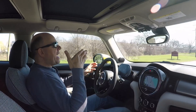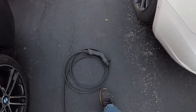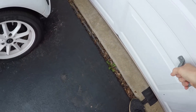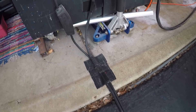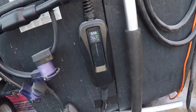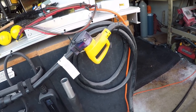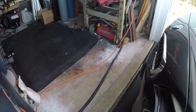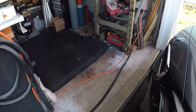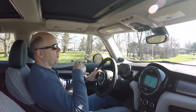That's our philosophy. I have my Tesla charger and my J1772 both running to one single Y-connector. You can see we've got our normal J1772 plug and also my Tesla charge cord — both run underneath my garage door. Inside, I've got my Tesla charger plugged into a Y-adapter, and then a basic J1772 — a 32-amp, 240-volt, level-two charger. Those both plug into one NEMA 14-50 line, which is 8-gauge wire running all the way back to my fuse box. That goes to a single 240-volt outlet, and yes, it's safe — everything is overrated for what I'm pulling through it.